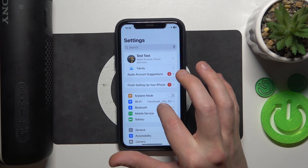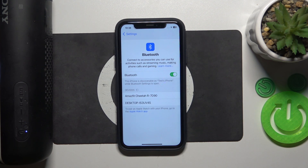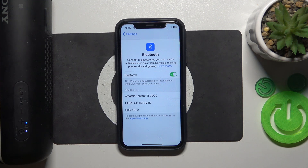If you have Android, also click pair new device. After that press the power button one time. Then press and hold the power button for at least three seconds to enter pairing mode. Now click on it in the device list.